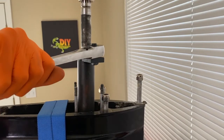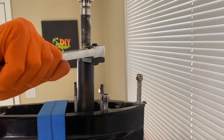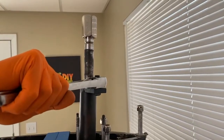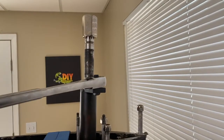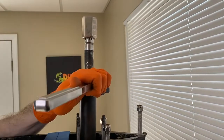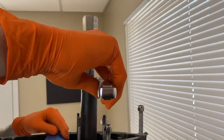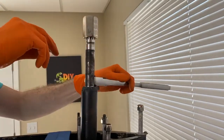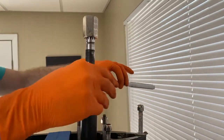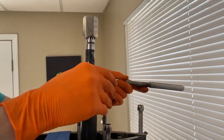I'm going to grab the lower unit with my left arm and hand to support it and try to loosen this retainer nut with my right hand and arm with the ratchet. It might be tough — and mine is. It's not coming loose, so I'm going to grab my rubber mallet and give it a couple of friendly taps. She's loose. Referencing that word 'off' and the arrow, I'm going to turn it two to three times — probably two and a half.